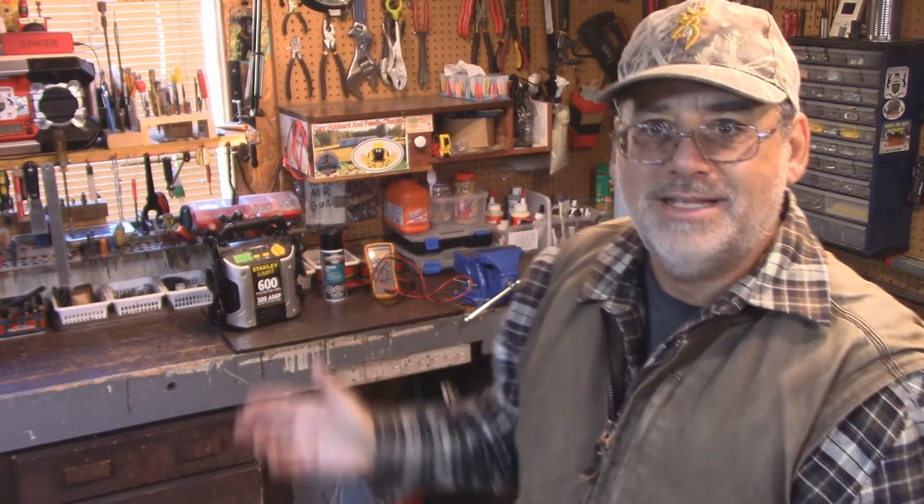Well, what do you think? That wasn't too bad — a little bit of a struggle there with the voltage drop. You could see them small little eyelets I had bolted with a nut and bolt onto the battery. When the battery's properly bolted on you have no problem with a good contact, but with them alligator clips it wasn't getting a good enough contact — far too much voltage drop. So as I started turning that over and it was going slow, I knew there was a problem. I rectified it and in the future I'll have no problem with the jump pack. And that's pretty much it — the video for the storage of the diesel engine.